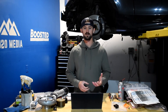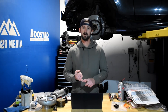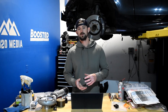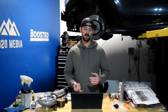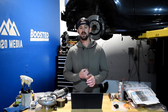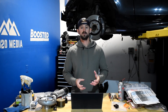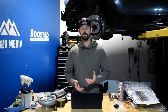Whereas when you have these additional supporting modifications, you can get there more easily because you don't need to be as aggressive with your tuning. If you want a really simple setup just to add a little bit of additional power to the truck, drop a plug-and-play Banks Derringer or Edge Pulsar on it and throw an intake on it and call it good. If you want to push the engine a little bit more or provide additional reliability and a freer-flowing engine, then get the exhaust systems done — the cat-back as well as the downpipe — and add an intake horn. Even with these mods, you'll want to at least look into the EPC solenoid fooler or transmission tuning, because all of these mods will put you pretty easily into the 500 wheel horsepower range, which is when the Allison 1000 starts to lose a bit of its reliability.